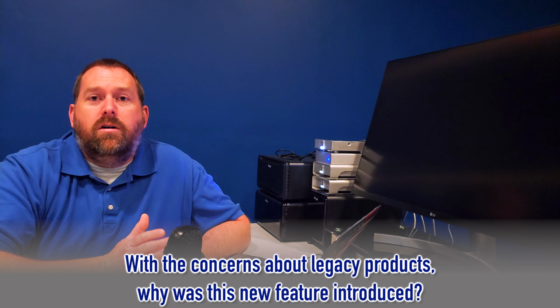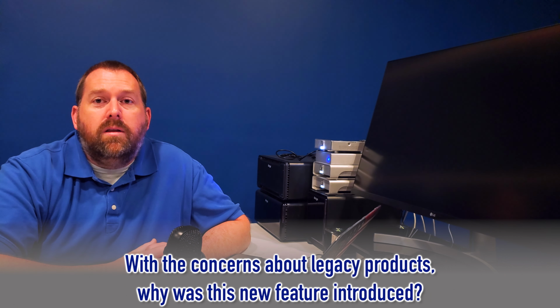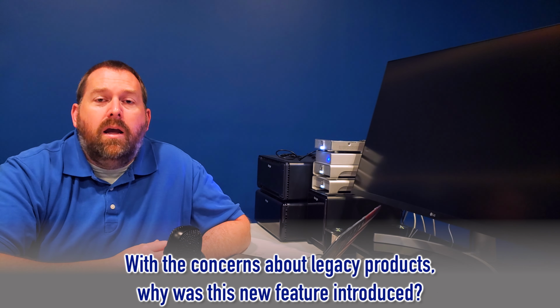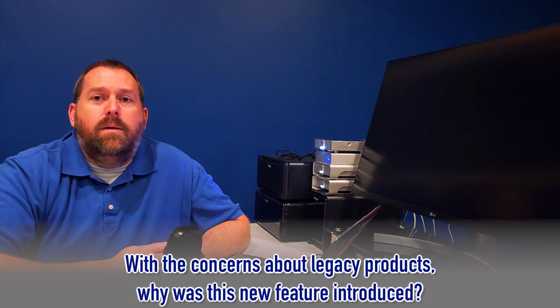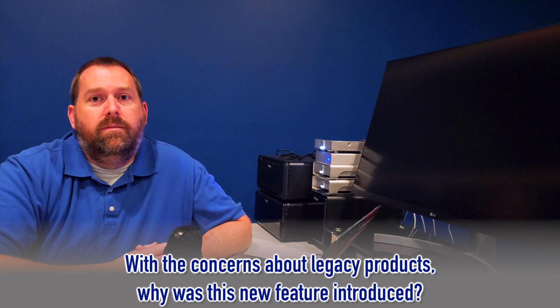So SATA hard drives are often deployed in storage enclosures that use SAS backplanes. So it is important that this feature be implemented on SATA devices as well. In a SAS system that supports the power disable feature, the host can now remotely power off and then power on the hard drive to reset a device that is in the hung condition.